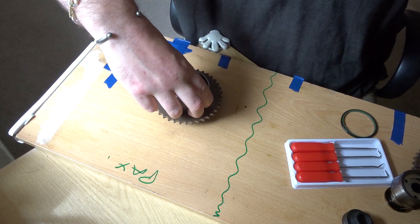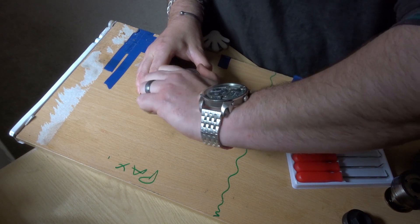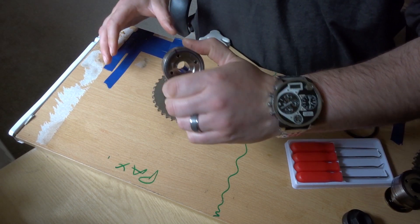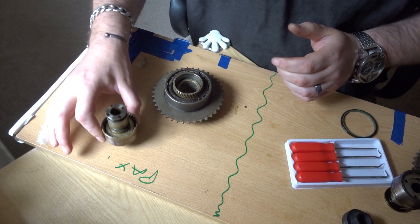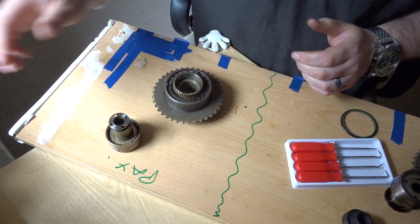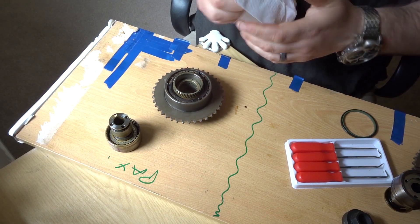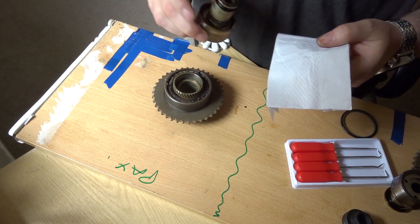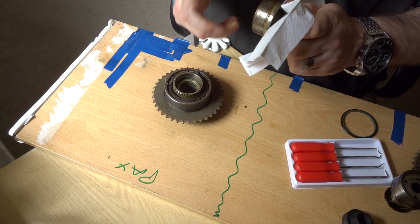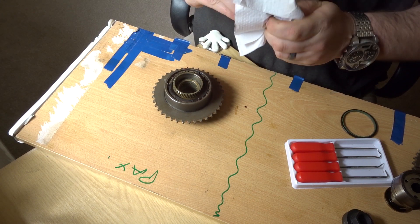What we do now is lift the center shaft out. As you lift it up, it does rotate ever so slightly. There is a sort of an emulsion-y, oily mess on there. I used a degreaser that is rinsed up in water, so I degreased the VANOS gear set and then rinsed it with water, which is why you're seeing the emulsion there.